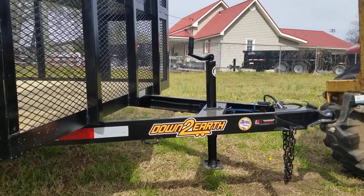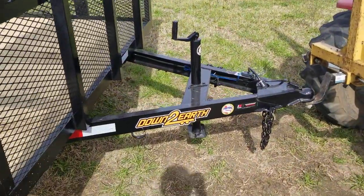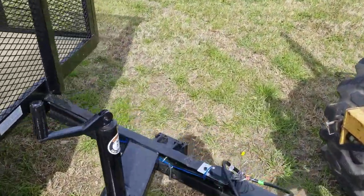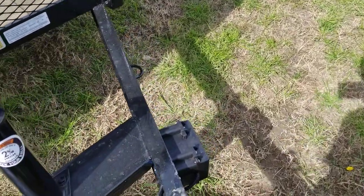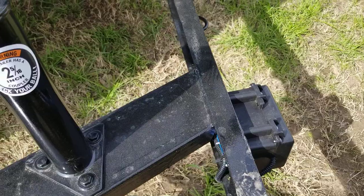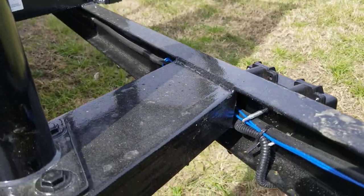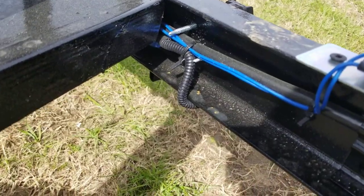With the setback jack, you can open your tailgate on your truck, which you do a lot when landscaping. This trailer has brakes on it — you've got a breakaway kit with your battery in there, so if it ever comes disconnected it'll lock the brakes up.